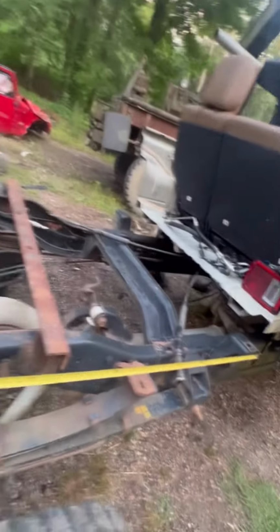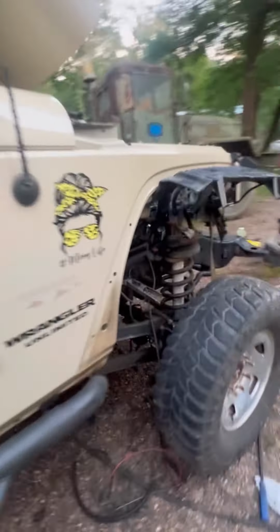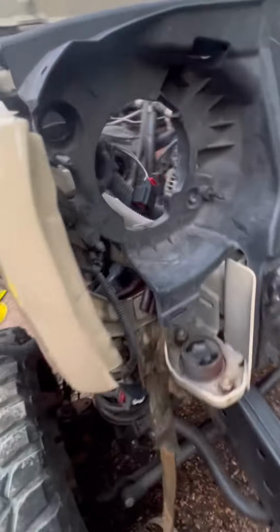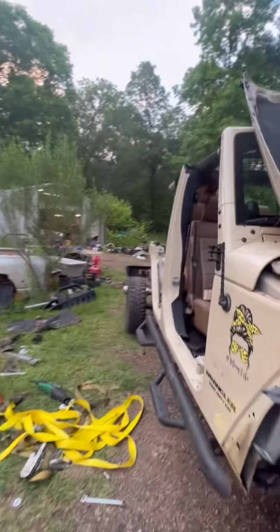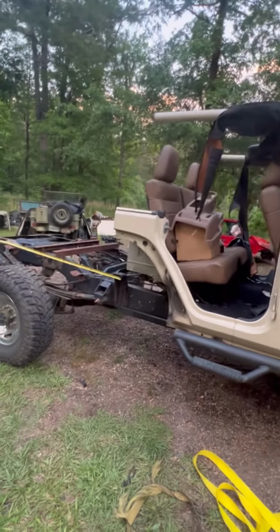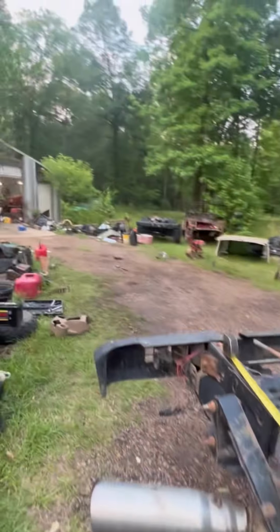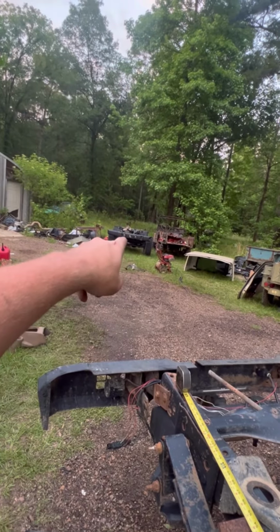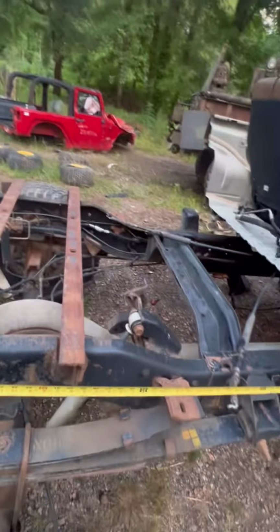And then for the fuel pump wires, they actually are in this plug over here. I didn't realize it, but they come out of this plug here, and that's on the frame still over there. I just left it on there so I remember which one's which. Being a 12 valve, there's no electric fuel pump. It's just manual. So that makes it pretty simple. I just need a couple of fuel gauge wires, which are the factory wire for the Jeep, which goes to the factory harness of the Jeep. So it should be kind of a direct plug and play, I just have to extend it to match.